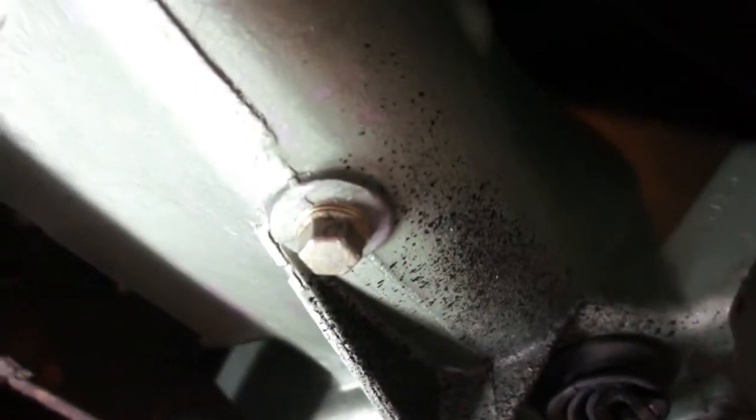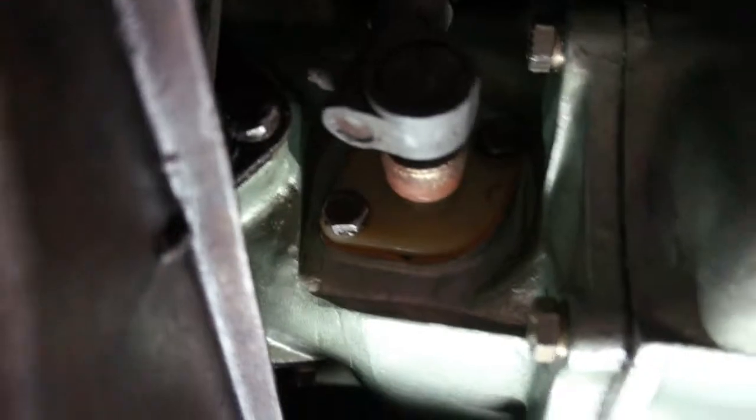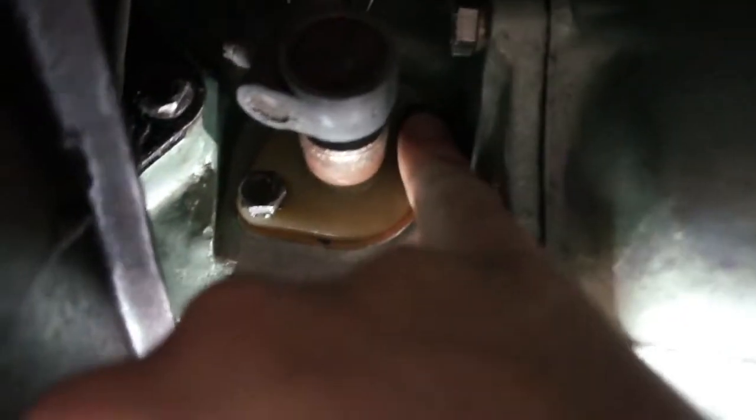Okay, so back underneath for one last time, you can see the tube coming through, draining the remainder, just letting it drip as much as possible. And then come back down here, retighten the two bolts, make sure that they're snug, make sure that this is snug, there's no leaks. Obviously you don't want any leaks anywhere, so check that. And then reconnect the speedometer cable here.